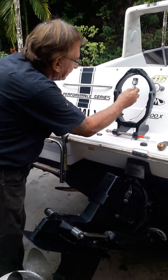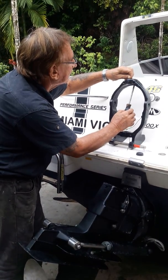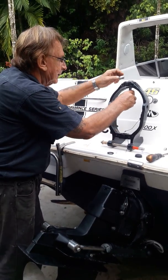And you knock that up through here — the old one out first. Take the seal out; the seal is up in here too. You just go between here and grab the seal out, and then with this push the bearing out.